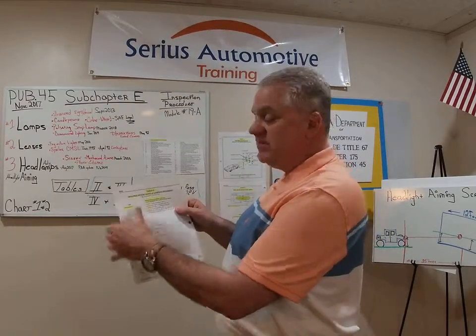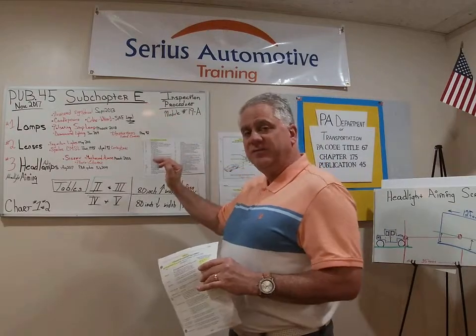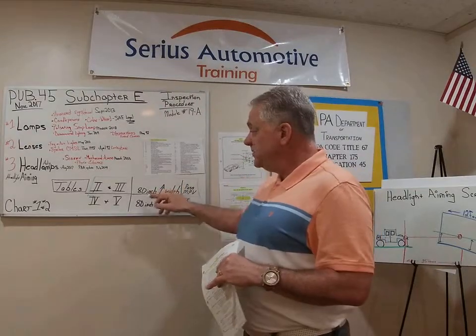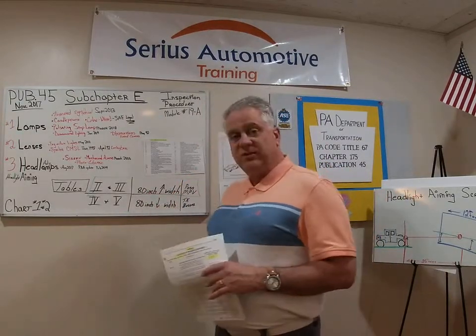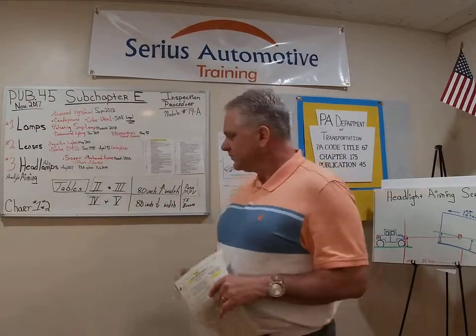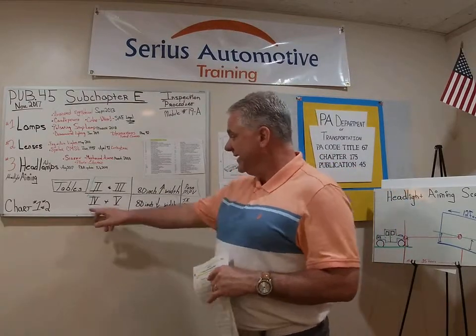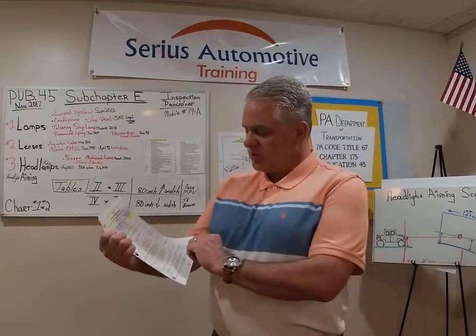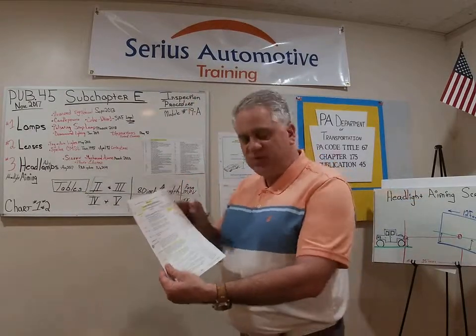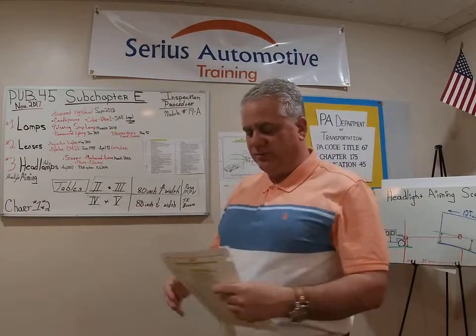In the chart it tells you headlights need to be white, regardless of which vehicle you're dealing with — remember we're only in passenger car and light truck. A multi-purpose passenger vehicle could be over or under 80 inches. For example, a Chevy 1500 Suburban is under 80 inches; a three-quarter-ton Suburban is over 80 inches — so you'd use Chart 4 and 5 for the three-quarter ton, and 2 and 3 for the 1500. The key difference between the two categories is the ID lamps and clearance lamps mounted on the top and rear of the vehicle.